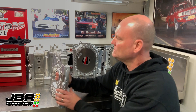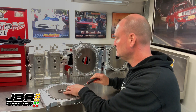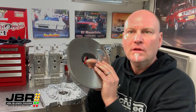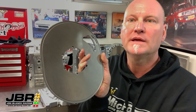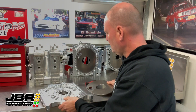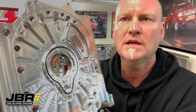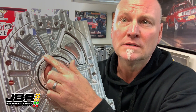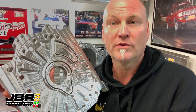The plates themselves are a two-piece design with a removable face plate like so. These face plate inserts are made from cast iron, surface ground flat, and nitrided to harden the surface so it's wear resistant. They're held in place by these six screws around here. Behind the face plate, on the plate itself, there are two o-ring grooves machined in. This o-ring here stops water getting into the oil and making a milkshake in the sump, and this o-ring here seals the intake port so no water ends up getting into your motor.